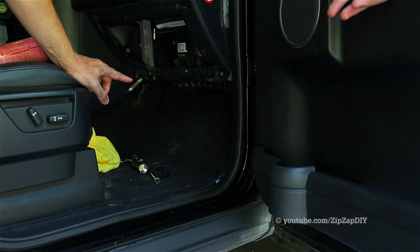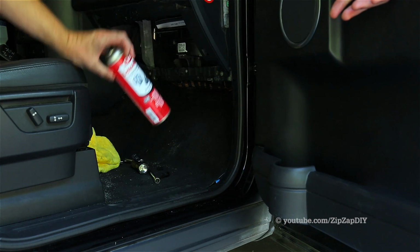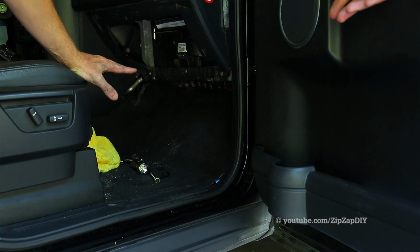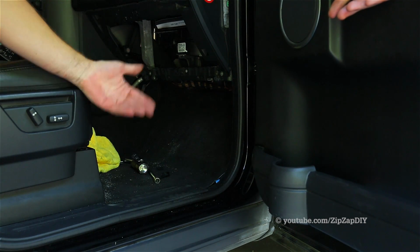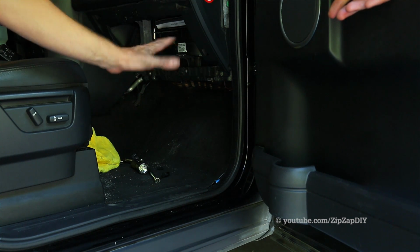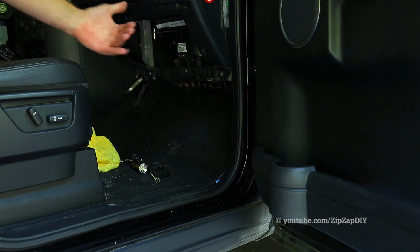I've put the CJB back in. I've got all the connectors cleaned with my electrical parts cleaner. And some things to note when you're working on the CJB, you do not need to reprogram the truck. You can pull it out, put the existing one in, and there's no problems. If you put a new one in, it needs to be programmed.